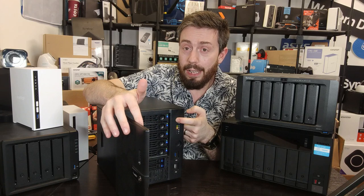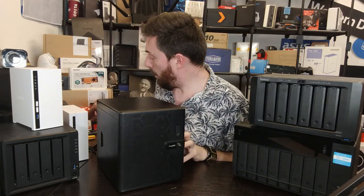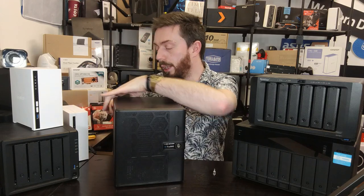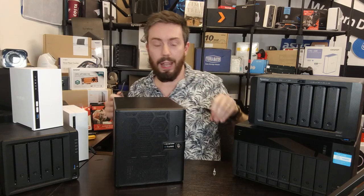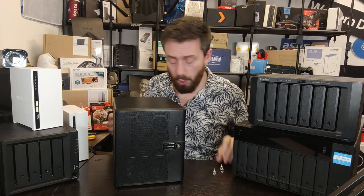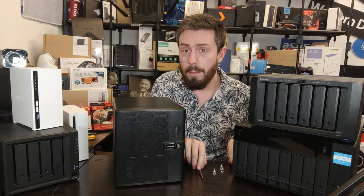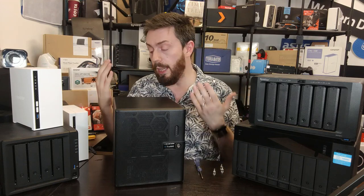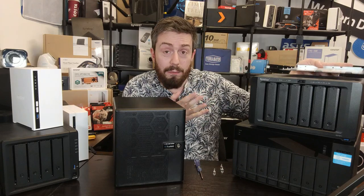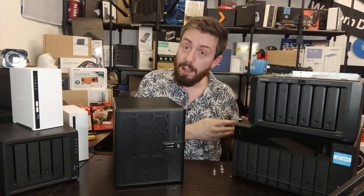I'm just going to unsafely power this down — don't do this at home. Now let's look at the hardware inside. Removing the external casing: it's a tidy cable arrangement inside, there's the big PSU on the side, and we've got two sticks of RDIMM — two sticks of 16GB DDR4 ECC memory — in a four-slot board. Worth highlighting also about the iX Systems NAS: unlike using TrueNAS downloaded for free, with this you get branded support rather than relying purely on the free community forums.